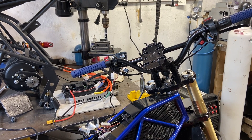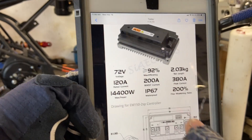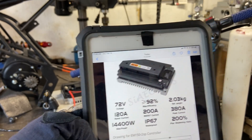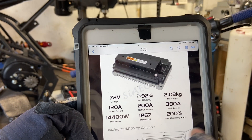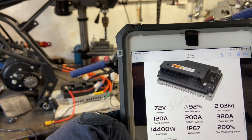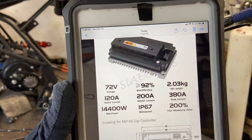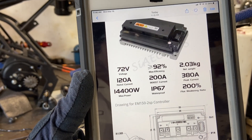Let me show you real quick. This part right here — the 250, 200 — that's for instant throttle response. It says 14,400 watts, but mine's 17,000 watts, so we can go over those numbers later. 380 amps would be your phase current. On your wires, go to your wire diagrams included. This is my sport mode: I want the brown wire to the black one — this has a black with a small brown one. You can check how the switches work in your display. That's my sport mode on/off; I don't run a display but I can tell the difference when it's in sport mode.